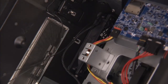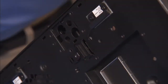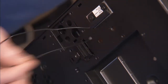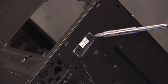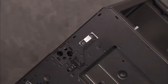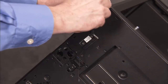If you are replacing the main number 1 antenna, free the antenna 1 cable from its remaining cable clip on the rear inside wall of the chassis. Pull the antenna out through its access hole to the rear of the unit. Detach the two Phillips number 2 screws that secure the antenna to the rear of the unit. Pry the antenna off of the unit with a flat-headed tool — it will take some force to free the adhesive.